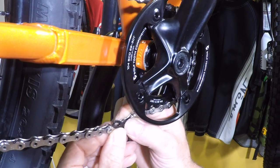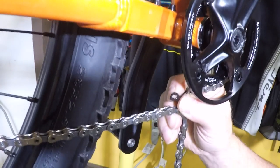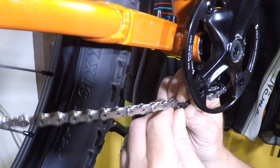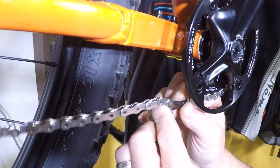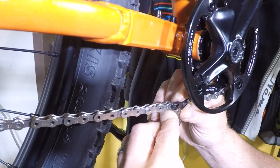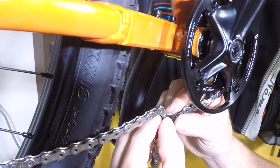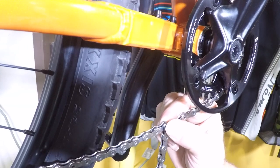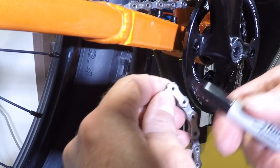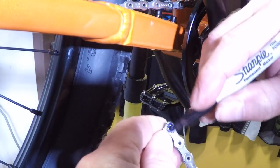You're going to line these up. What I mean by 'meet' is that the master link will match an area of the chain it can connect to. I can take out that pin and it would fit perfectly right here. But I won't do that because then I wouldn't have any room for the derailleur. You're supposed to add in two more rivets to account for derailleur room — so that's one, two. I'll mark this one as the link that has to be removed, and we'll break that one out.